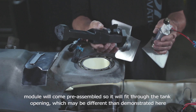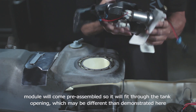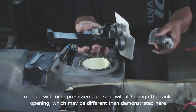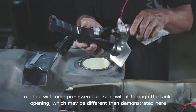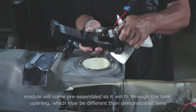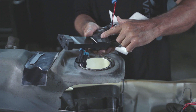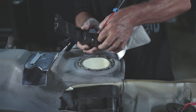When you get your triple pump module, you are going to find this assembly here — leave it like that — and you are also going to have this other pump already rigged up with a cartridge on top of it. We are going to slide each of these into the tank, oriented so that this slides into the pump retainer right here. It is very important that you orient this face so it is parallel, so when you slide it up in place, it locks in and then you can tighten this.